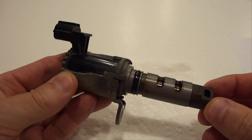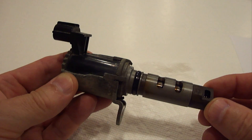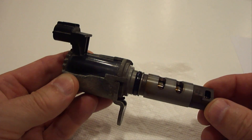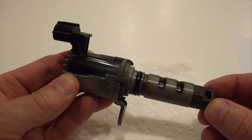If you don't replace a bad oil control valve it can cause severely reduced gas mileage, rough idle, engine RPM fluctuation, and even cause the timing chain and gear assembly to wear prematurely. It could even break the timing chain and gear assembly, which could end up costing thousands of dollars in repair bills.